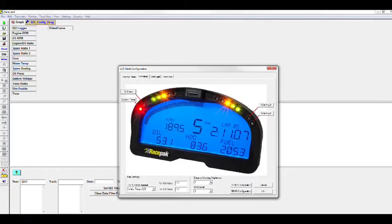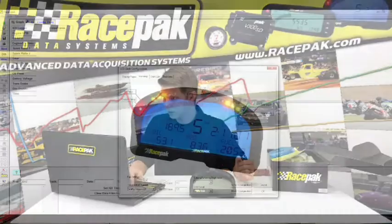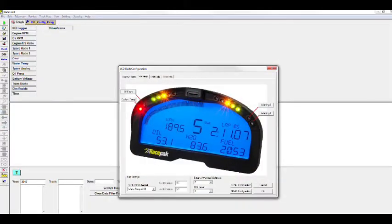It's just a matter of clicking on that little box and putting in if you want your oil pressure to light up at 20 PSI versus, let's see what we have in here real quick. Let me double check for you. We have oil pressure set at 20 PSI from the factory. So if you want it to actually illuminate the light, I know some stocker guys, they hardly run any oil. So sometimes it goes to 4 pounds of oil. So you can basically change that number to whatever you want.